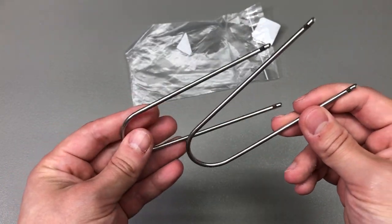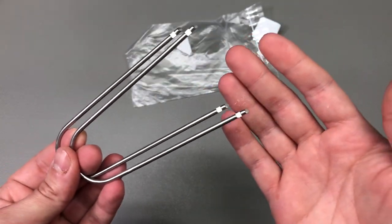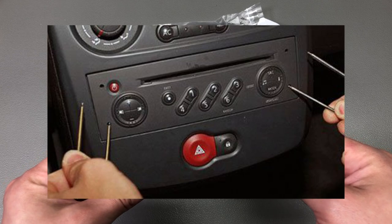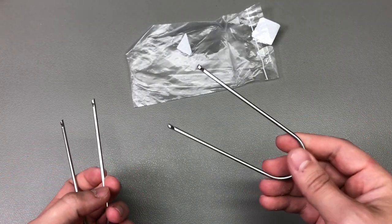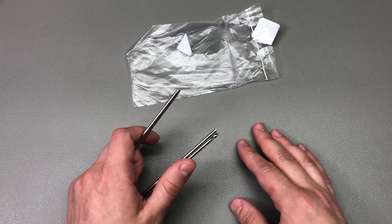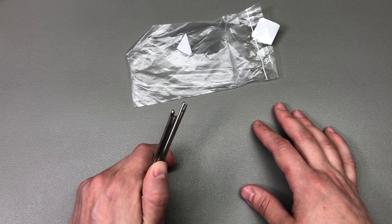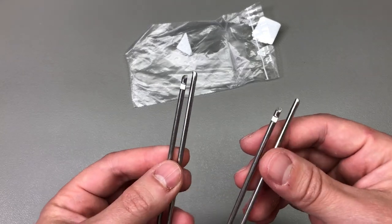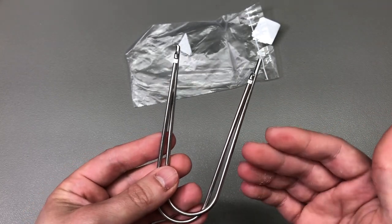Next I ordered one of these car radio extraction sets. You need these to extract the car radio or CD player from older cars that have four holes on the sides. You insert these clips, one on each side, to unlock the radio clips, then pull using them as handles to remove the radio. If you have an older car and plan to upgrade the media system, you'll need one of these. I remember years ago a friend asked for help upgrading his car radio and we couldn't find these anywhere, so we fabricated them from welding rod cores based on pictures we saw online, and we managed to get the job done.